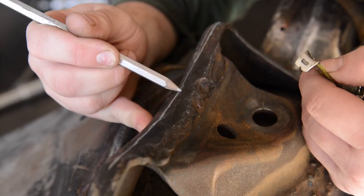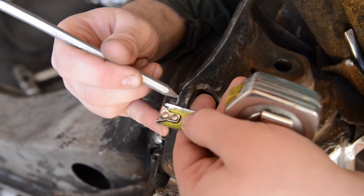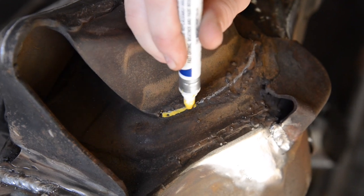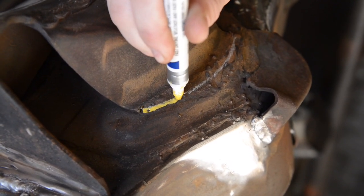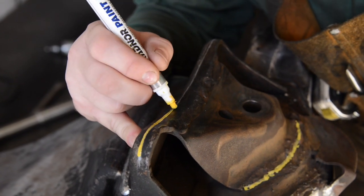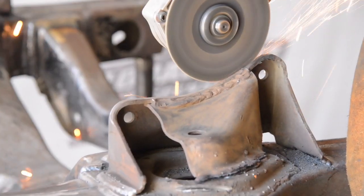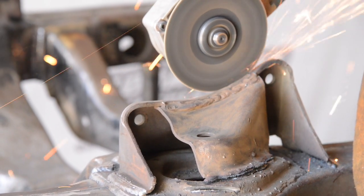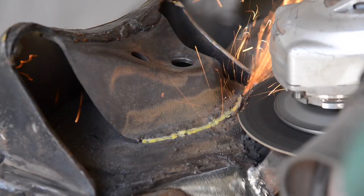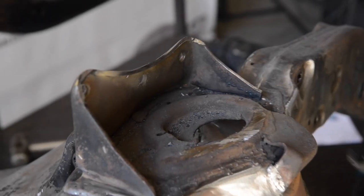One of the first things you want to do is measure 3-7/8 inch over on the upper frame mount — that's from the engine side out. Draw a good line there, because that's going to be your cut point. We're using a yellow marker; it's a lot easier to see when we're cutting. The center section has to be removed, because that's where we're going to put the extended travel mount. You can see us making a nice straight cut through and popping it out.